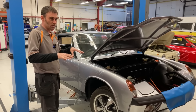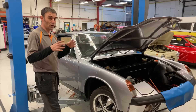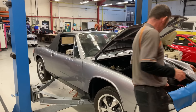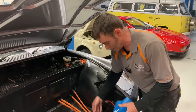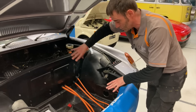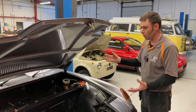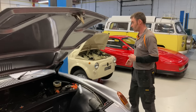We've got a really dialled-in setup now for these conversions. What we've done is a dry build — a dress rehearsal. We made sure everything fits, the whole loom and everything went in, and then we stripped it all back out again because we want to make a kit. Anything orange in the cars is the dangerous bit — that's your high voltage. You've got a high voltage loom going through the car and a 12-volt loom. We do the conversion, design it all, put it in, make sure it fits, and then take it all back out.